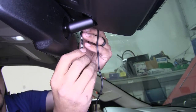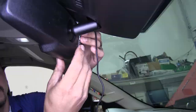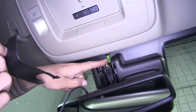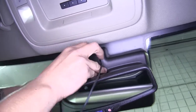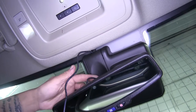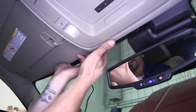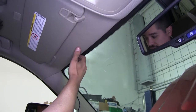We're going to run the wire back down towards the brake pedal to meet up with a couple of wires at the air cylinder. To hide the wires, pull down on this plastic panel and take the center section out so we can tuck the wire behind it and follow the headliner across. Make sure that sticky tape doesn't come off when you start pulling the wire. Clip everything back in and you'll only have that little bit of wire sticking out right behind the mirror. When running your wire, pull on the headliner slightly and tuck the wire underneath, then run it down the pillar and down the side panel.